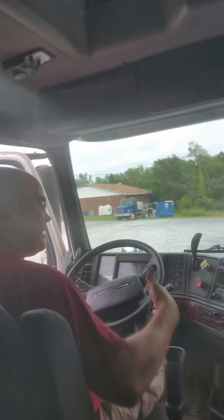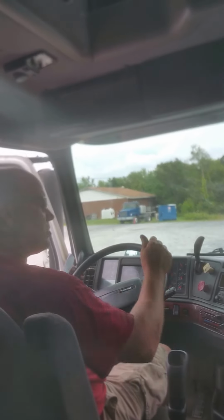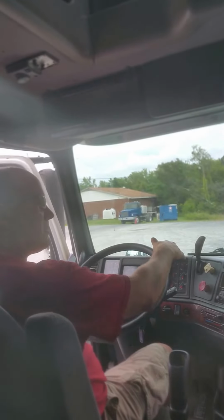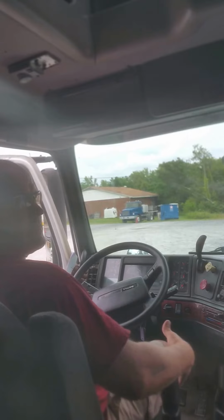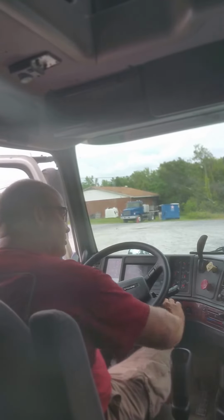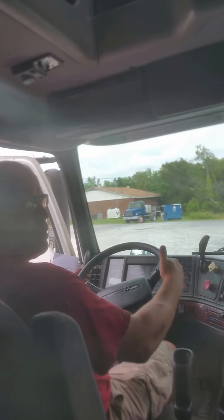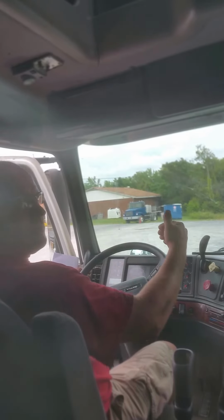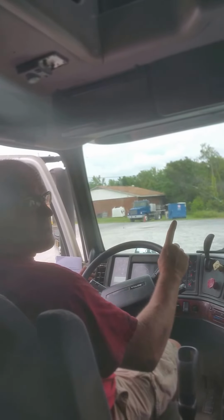So when you get in here, you're going to put it in first gear one time, check your parking brakes, trailer, tractor, check your service brakes. Both buttons will be pushed in. Your truck will already be in first gear. You're going to shut the key off, turn the lights back on, and then you're going to put your foot on the brake pedal for 1 minute. Make sure that the truck doesn't lose more than 4 psi in 1 minute after the initial air loss.